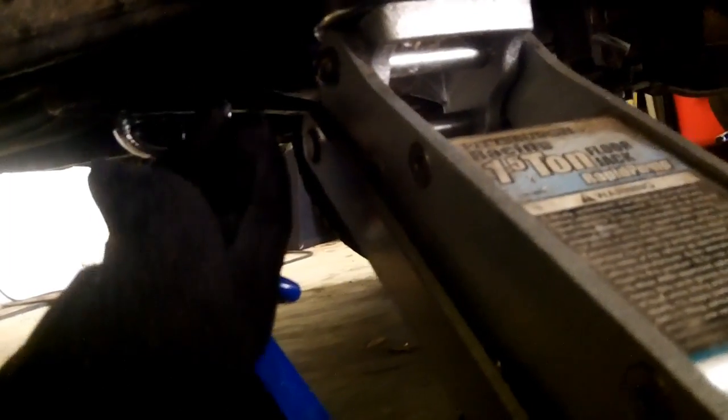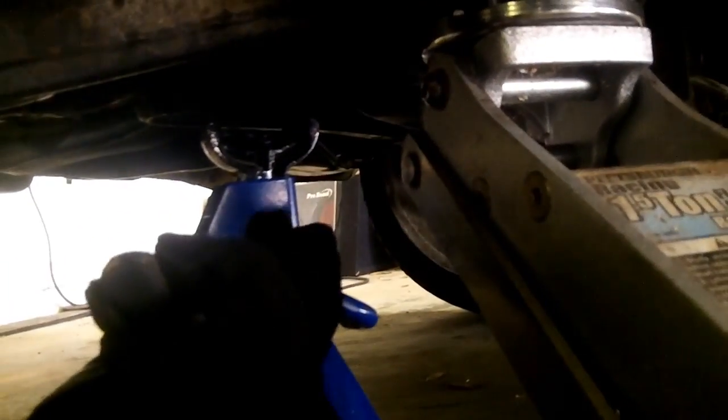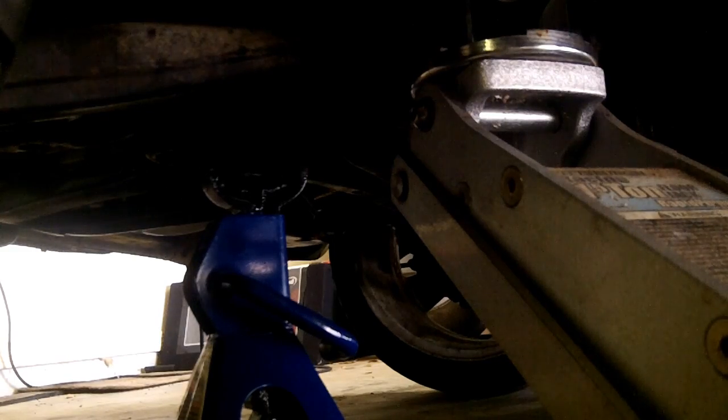It gives me the most comfort, the most safety. Once I release it and set it down, then I know that my jack stand is inside of that lip on the cross member. If you're skinny, you might only need one notch. Me, I need two. If you have a rounded edge jack stand like this, that is a pretty good location, because the rounded seat on the jack stand will sit right on that edge for the lower control arm. I think that's a really good place to put it, but I like having the external lip as a little safety lip for the cross member around it. I'll use that as a jack point, and I'll put my jack stand within the lip of the cross member.